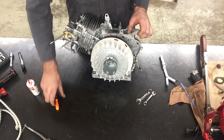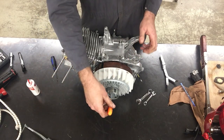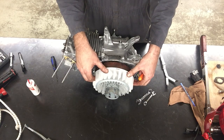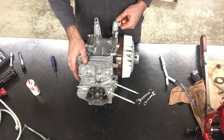On the front of the flywheel we have a little triangle arrow. When it's pointing straight north — one hundred percent straight up — that's top dead center for the piston. We have just confirmed it to be on the compression stroke.